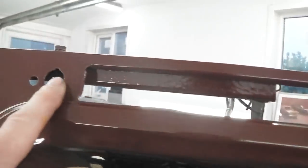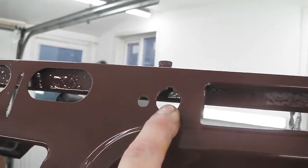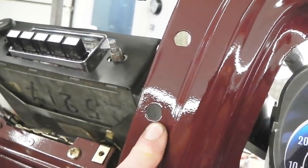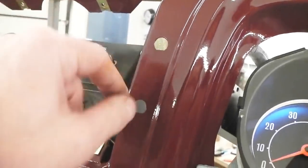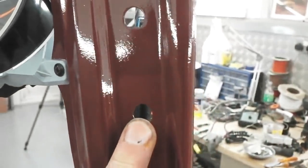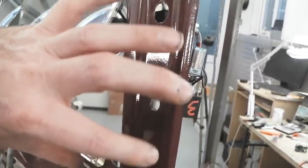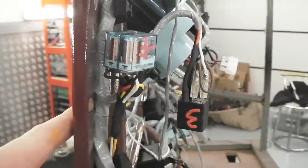But on this side, Canadian spec wiper indicator, or whatever it was, pre-punched out. Wiper switch, we need that. Then a spare. Okay? So we're going to use this spare for the fog lights, because we're having fog lights as well. So we've got a spare hole, and the hazard hole is already pre-punched. Even if your car doesn't have hazard lights, it's blanked off with an aluminium trim piece, commonly known as hockey stick, which fits over that whole piece. Behind your hockey stick you'll find a hole, if you've not got hazards, for you to fit them.